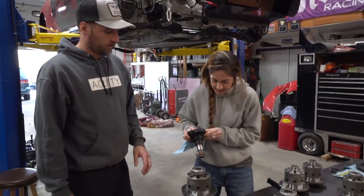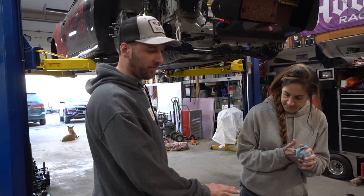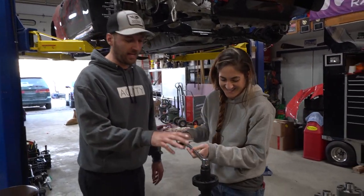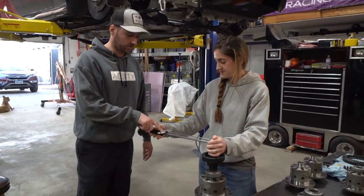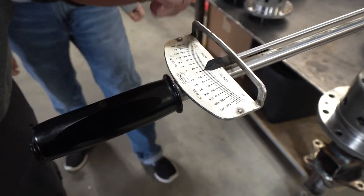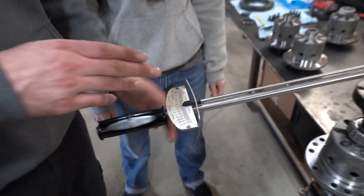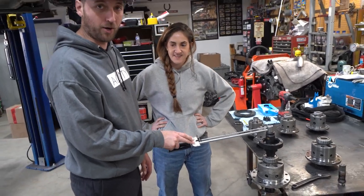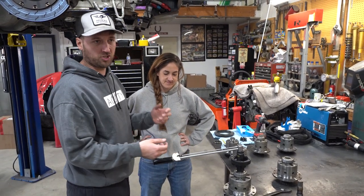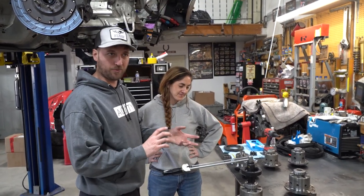This is the one that came out of my car last year — the one that has the vibration in it. It is set specifically for the size of tire we run and the weight of the car. We use a beam-type torque wrench set at zero showing foot-pounds. Keep in mind these are not specific precise numbers — just comparisons from one unit to another. When Tiffany pulls on the torque wrench, it'll show at what pound it breaks away and at what torque it holds throughout the swing. That tells you, going into a corner, how much it takes under throttle for the LSD to break free and how much torque it takes to keep them broken from each other.